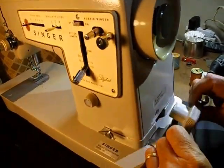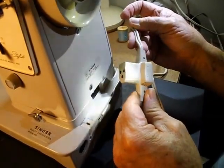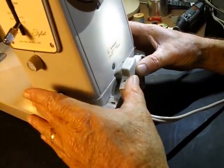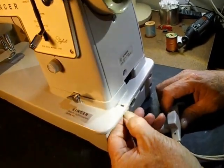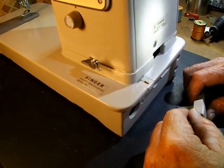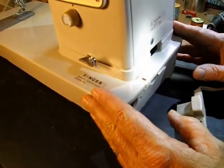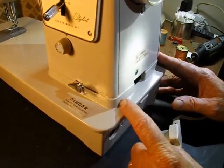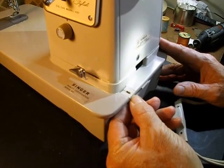This has a three-way cord — one way into the machine, one way to the electrical outlet, and one way to the foot pedal or speed controller. It just simply plugs in like that. If you've ever seen these little painted rubber pieces and wondered what they are — this will pull out and go around a cord. This is table or cabinet mountable, so if you do want to mount it into a table, this would allow for the foot pedal cord to go inside the table to the knee lever. That's what that little rubber gasket is for.